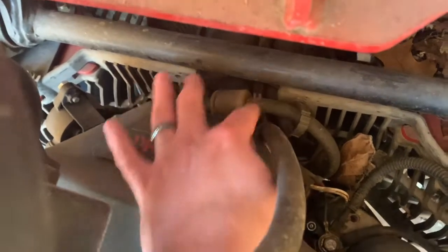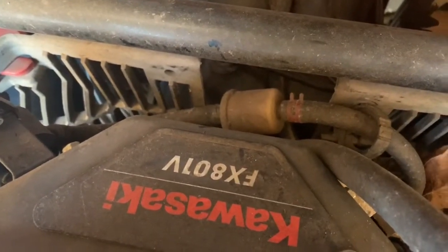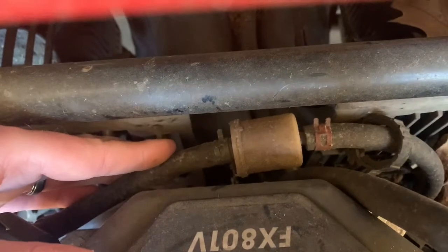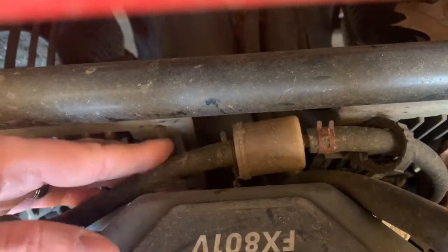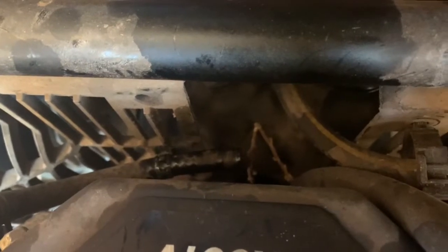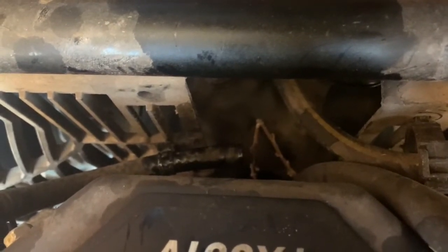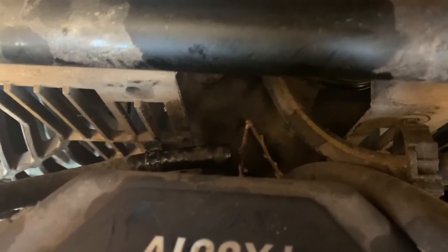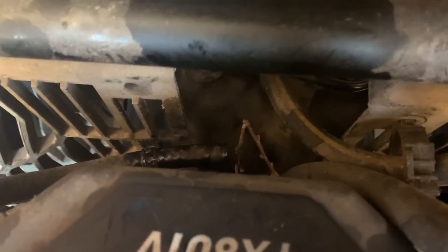It's a little cold out here so we're working in the trailer today. Back here by my engine I have my fuel filter — it's a little bit dirty back here, you can tell it is definitely time for that thing to be replaced. We just have two clamps on the side. We're basically going to pull these clamps to the side and replace the new filter. Our special effects team just pulled that filter right out of there — we got that filter removed.